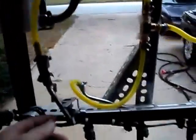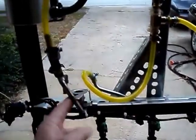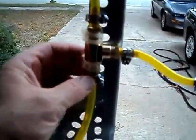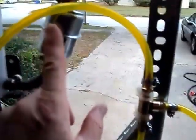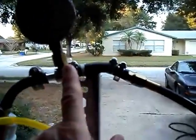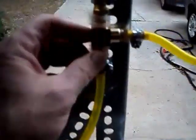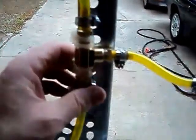It's getting late, and I'm just now finishing up doing the fix on the dual line input for the cleaning fluid. I had to use some plumbing brass with some barbed ends and some additional Tygon line to feed the fluid down through the cylinder, through the gasoline filter, through the pressure gauge, down into this T-bar, this brass T-fitting with a barbed end here, here, and here.